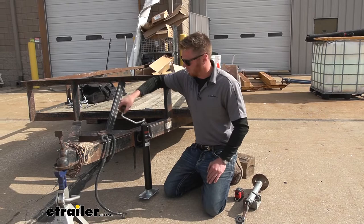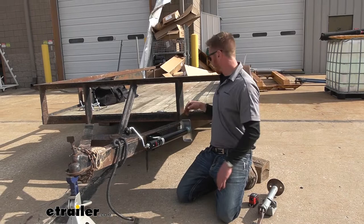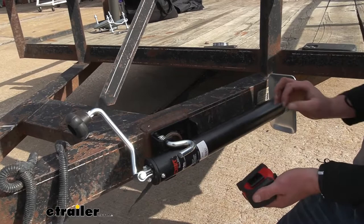Whenever we're done hooking up to our trailer, we have this little pull pin — pull like that — and then we can go ahead and rotate it. Also, a lot of times you put some breakaway switches or some junction boxes on the side of your trailer, so when it's completely retracted it's going to be about 21 inches or so, so keep that in mind especially if you add stuff to your trailer or you're finding a good place to put your mount.